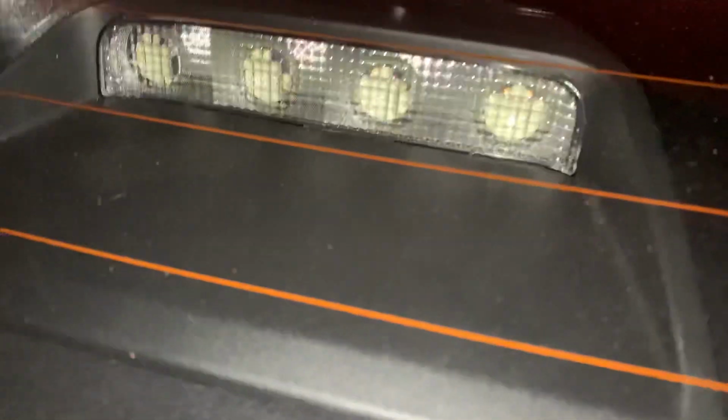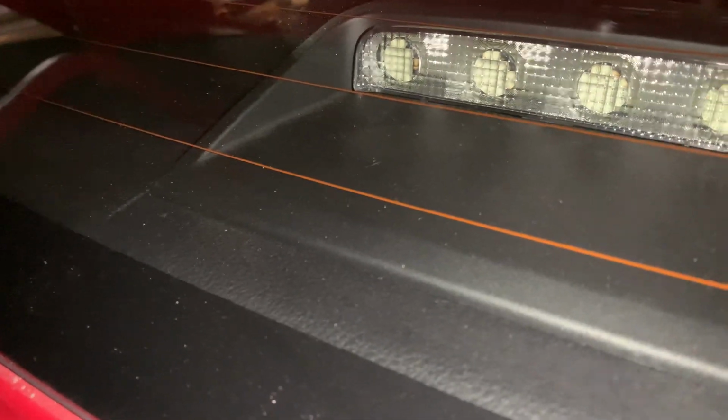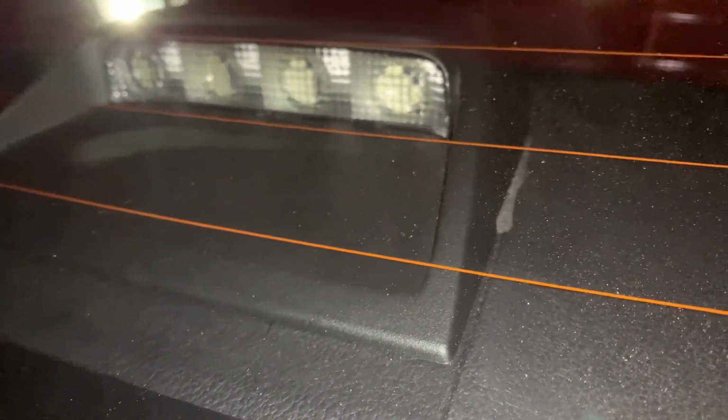So, as you can see, there's like next to no clearance here. In the cold weather, the exhaust, your bass, whatever it may be, causes that loud rattle because it's plastic against glass, and it may not look like much, but that will bounce. There's not much retaining it. So all the foam in the world is not going to fix it. What you have to do,